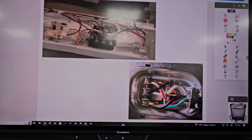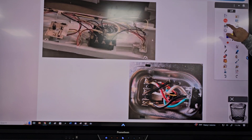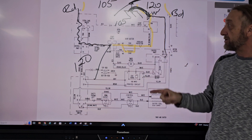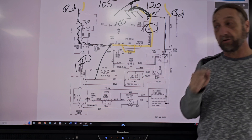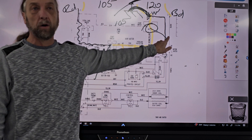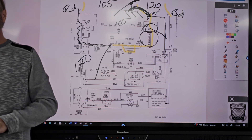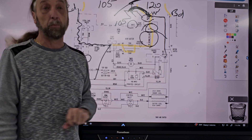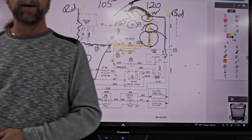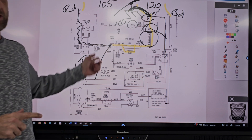You have to be able to see the circuit. You have to be able to know — if I asked you where is this part, you have to say, that part is right here, and it's this cable and this cable. Because if I say I put my meter lead on NO, where are you actually putting your meter lead? On the door switch — brown and yellow. Not only do you need to know what part it is, you also need to know the color of wire at that point. Because now you've got to go to the machine and check that point. Any questions on this dryer?